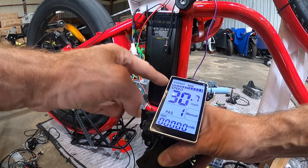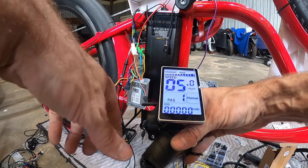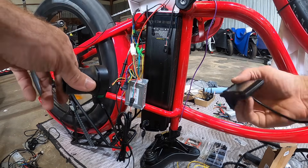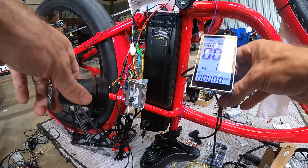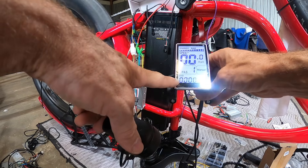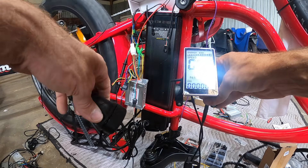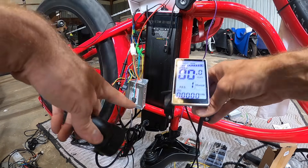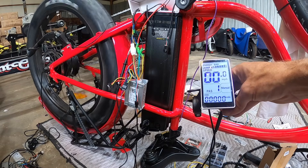For example, with this particular display, controller, and motor I get a speed display. But if I use the electric controller I don't get speed output, and same with another display type — I can't get a display at all. These displays here seem to work fantastically and aren't picky. Other controllers were giving error 10 codes on other displays, while this one would just come on but nothing would work. Anyway, that's enough — thanks for watching.